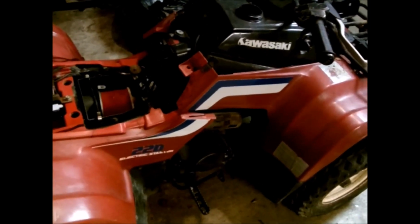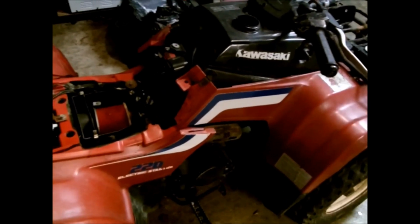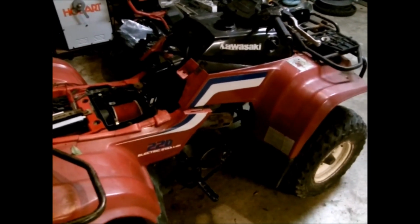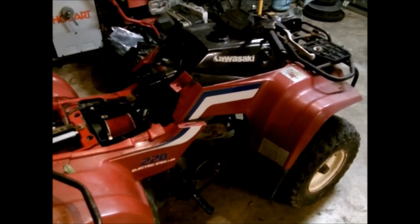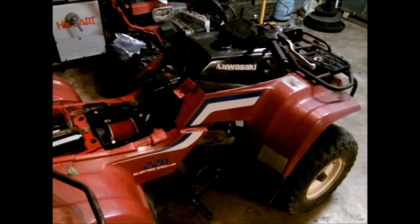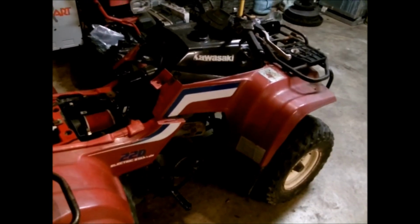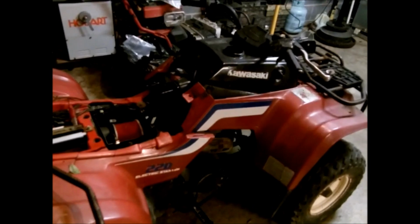I'm going to go ahead and get this carburetor off, and I will see if I can film the steps of me cleaning this one out. Hopefully I don't need a rebuild kit and everything's good. I'll just have to wire out the jets, and I'm sure it's pretty nasty inside with all the varnish and stuff that the gas has turned into over the 10 years. Alright, let me get this off here, and I will show you the next steps in the process.